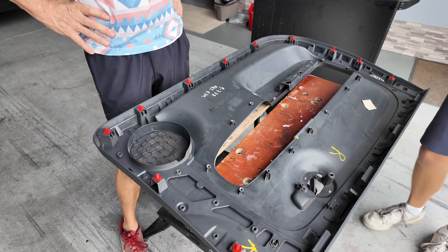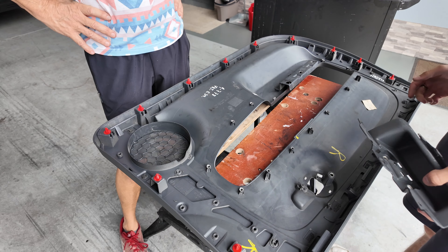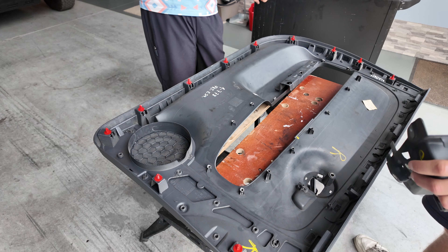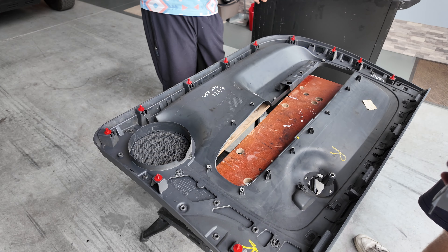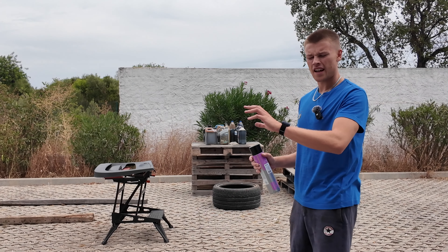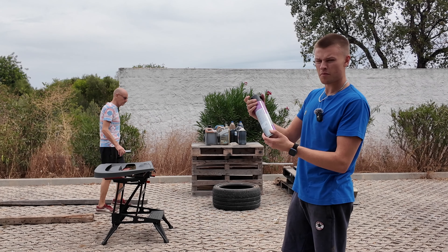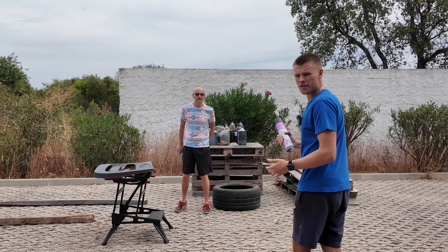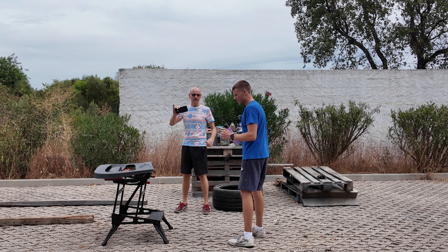That's it - completely dismantled, so we can paint this now. We can paint the door without worrying about damaging the fabric. We'll give the door one last wipe off with some degreaser and then we'll plastic prime it and get it ready to go. So I have degreased and got the surfaces ready and we're going to now use some of this plastic primer.